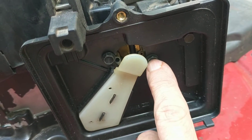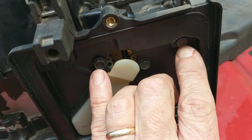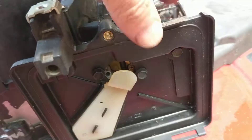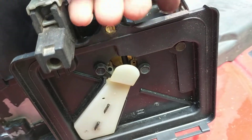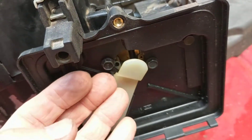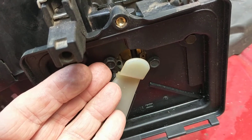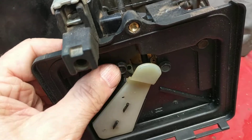On disassembly, I put cleaner on the back side of all three of these screws because the cleaner comes out the back. If there's a lot of dirt and corrosion and you try removing them, that dirt can cause the threads to bind and you might end up breaking something.